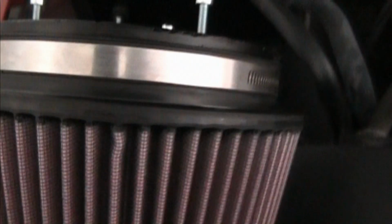That just bolts in, using the same bolt for the standoff bracket that came out. Now it's time to put the filter assembly on. I have the black donut inside of it already tightened down. So the studs go through the mass airflow sensor and sandwich the black donut that holds the filter on between this plate.